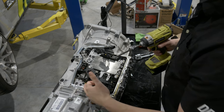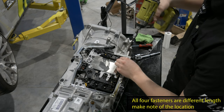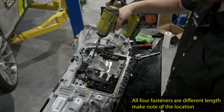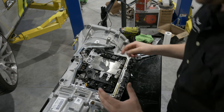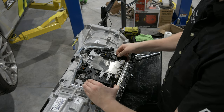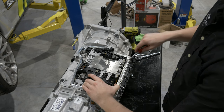Now while the sensor retaining screws are loosened, we can go ahead and remove the board screws, which hold the mechatronics board to the transmission. The first is going to be right here, the second right next to it, the third, and the fourth and last one. Now the mechatronics is loose, but it is being located on these two pins, which make it kind of difficult to remove sometimes. What I like to do first is give it a little wiggle, and then gently pry it up. Don't put too much pressure — you're just trying to walk it up the pins. Once it gets moving enough, you can just easily remove it.